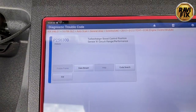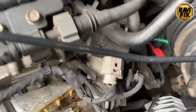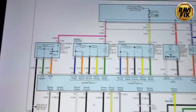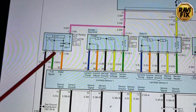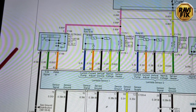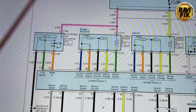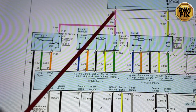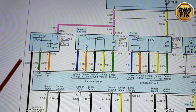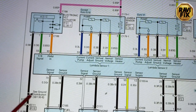I have the scope hooked up for further testing and I pulled the wiring diagram for this boost pressure controller system. Here is the wiring diagram. This is the boost pressure actuator, called the electronic VGT actuator - the component we need to diagnose for P2563. It's a four-wire connection. The pink wire comes from a relay and is the 12-volt feed for the actuator. The black wire goes straight to chassis ground.